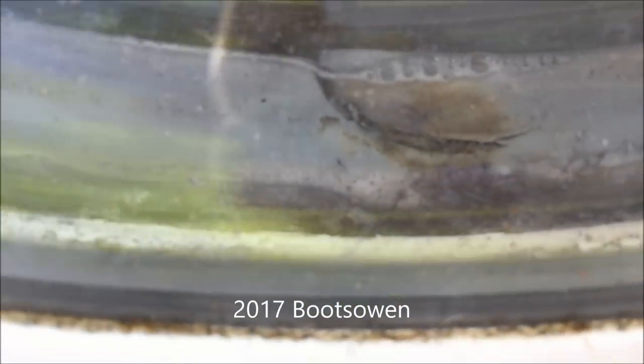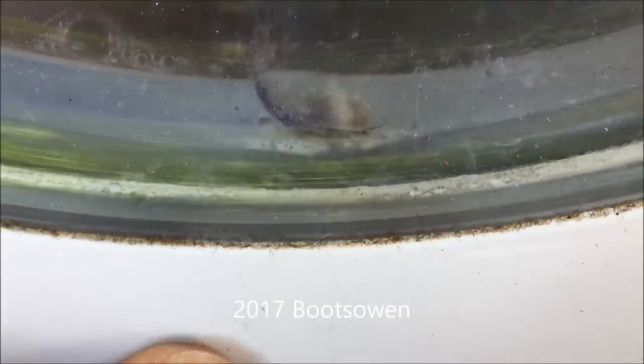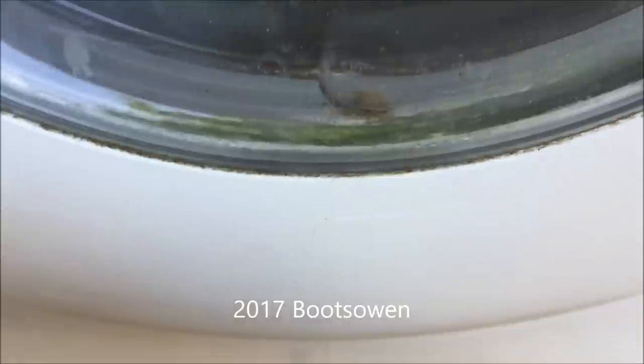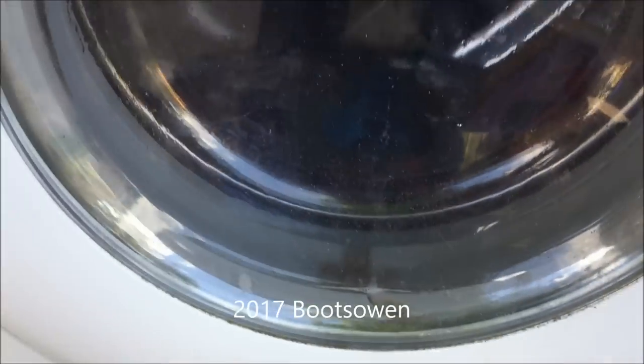Very little — you need to put a bit of pressure on it. So with the door under normal pressure, that little crack in the seal goes down too far and you've got this dribble running down the machine and a little puddle on your floor. So that's fault number one.